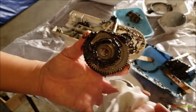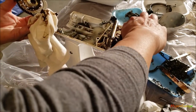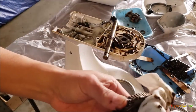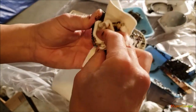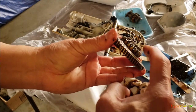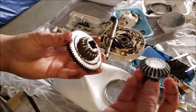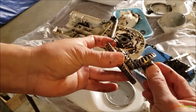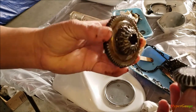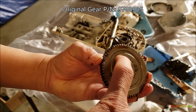That's why I'm saying you need a stack of cloths to clean up. Don't lose this piece of washer in here. Oh, it's just greasy dirt. Yeah, it's very obvious — the gear is completely worn out. Not so much on this one, but this one — I don't know if we can tell — it's kind of never gonna mesh like this. We'll compare it when we have the new one. You need to know the part numbers — they're always on the gear on the factory one.